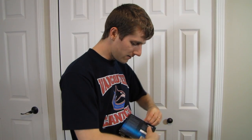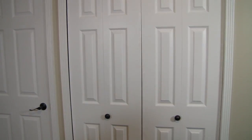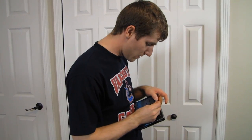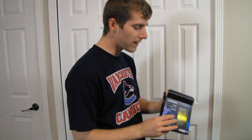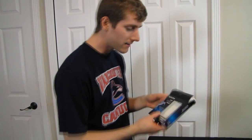That reason is that this is a SandForce drive. If you guys are familiar with SandForce drives, you probably know that they don't really come in 64 gig, 128 gig, and 256 gig capacities. Usually they come in 60 gig, 120 gig, and 240 gig capacities, and the reason for that is that SandForce drives have spare area.